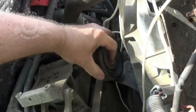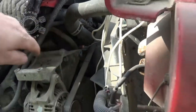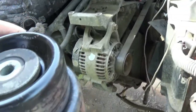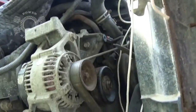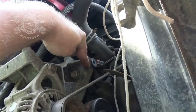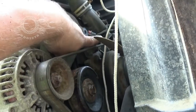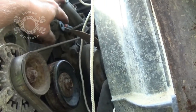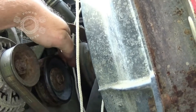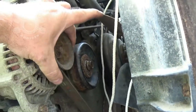This particular idler pulley here comes from the top right beside where your AC compressor would be. Does it work? Absolutely. You can go get a new idler pulley for your YJ that fits up here and use it down here — it's a little bigger than the bearing dad had but doesn't really make a difference. Now, you will need both pulleys because when you put your onboard air in, the belt will come off the bottom of the pulley, up over the air compressor. Here's how the belt configuration will run: it'll come from the power steering pump, across the bottom of the pulley, up over the AC compressor, and then the back side of the belt will run along the pulley and come over the alternator. Having this pulley in place gives you better wrap around your alternator.